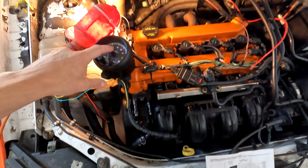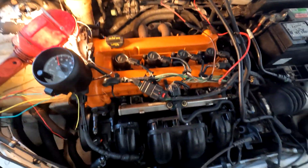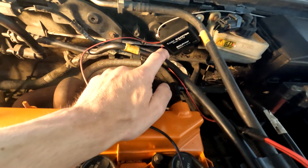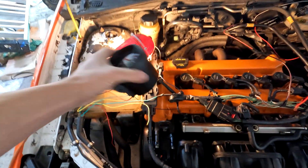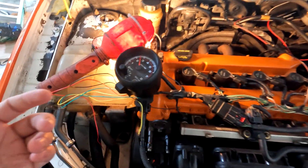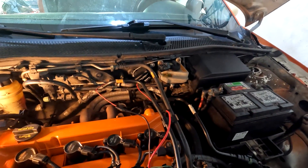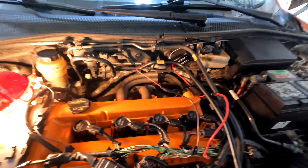You can go on Amazon and get a tachometer for 25 bucks, and it seems like you should just be able to splice into the wire going into the coil. But it's not that easy. Number one, you got to get one of these — that's a tach driver, about $105. This one's an Autometer; I'll put the link below. These things get horrible reviews. It didn't even light up when I wired it, so I went and got about a $60 one — that's what's in the car now, also an Autometer. So before you even start buying any other supplies, you're at about $170, which isn't bad but it's a lot more than $25.